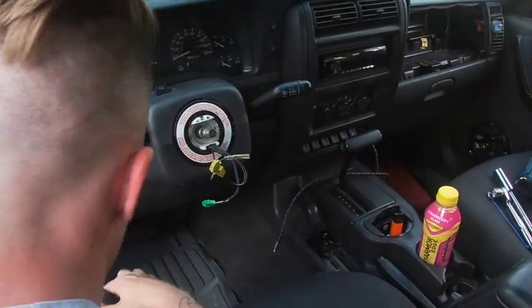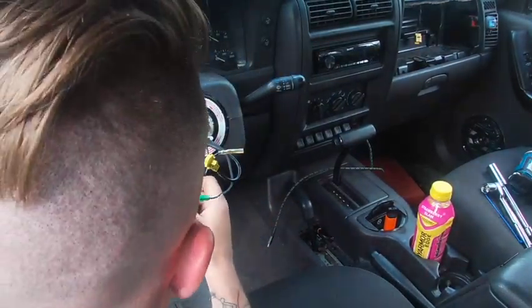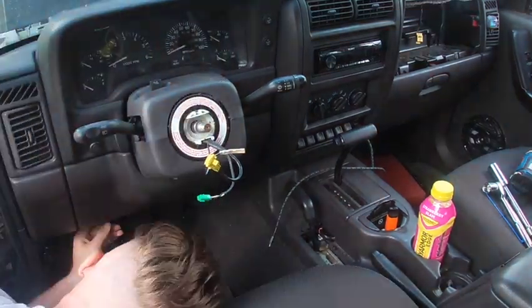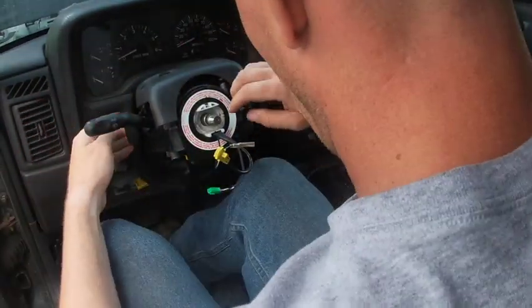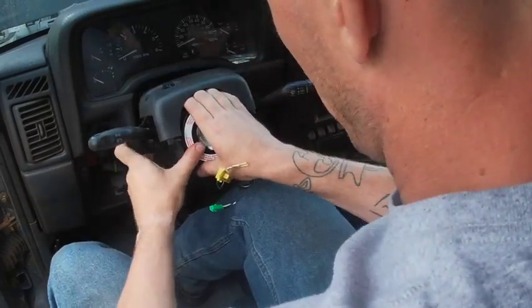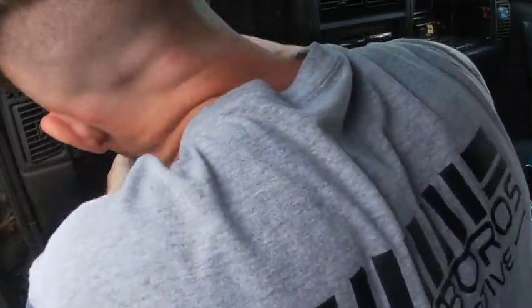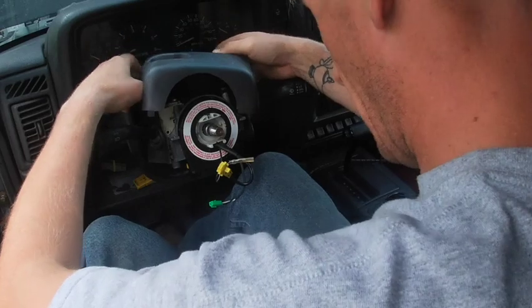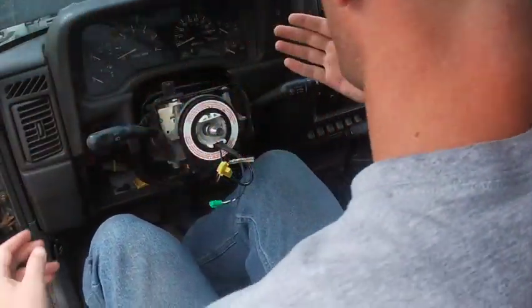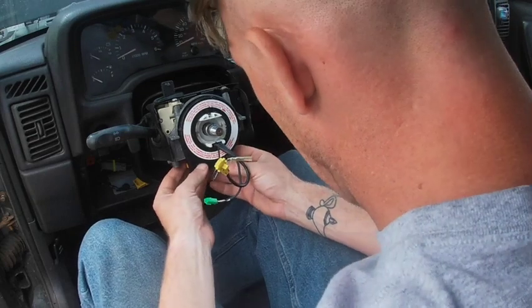Now we've got access to the cover for the steering column. I'm going to drop this cover down because I need to do a little wiring, then drop the cover for the steering column. Once the bottom shield is out of the way, lift up the top shield — you might have to drop your steering column. This is always a pain to get out because you've got to finagle a little tab around your height adjuster. You always think you're going to break it, but there you go.